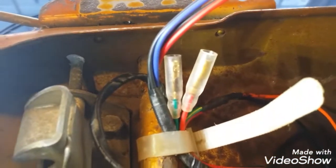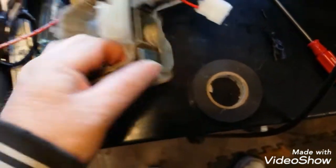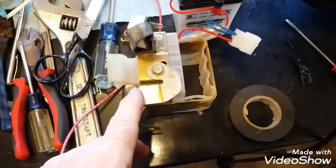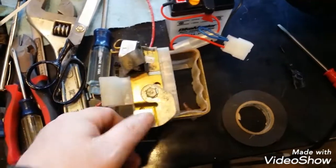These other two wires right there go to the rectifier. And I thought, well, maybe this is the rectifier. No, it is a flasher unit. So we'll leave that in there, and evidently there was a rubber mount or something here for a rectifier. So I need to get one of those coming. So for today, I'm kind of up against it wiring wise. I need to get a rectifier. I need to get the other end of that connector. But other than that, we're pretty close. Got everything else kind of tidy.